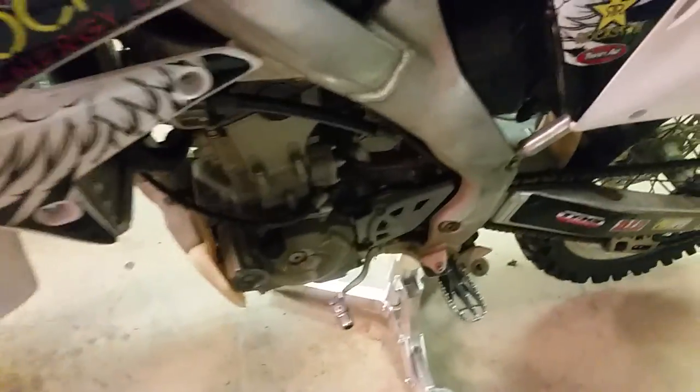There's the carburetor. First thing you're going to do is make sure the gas is off. And then make sure that you drain the carburetor. How I do that is take out that 17mm and have something to catch the gas with, because the gas will come out of there. So I'm going to do that step first and then get back to you.